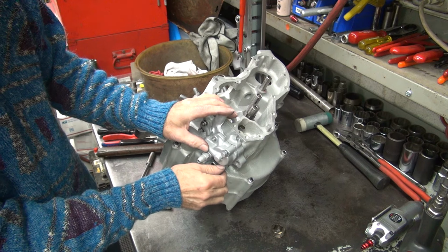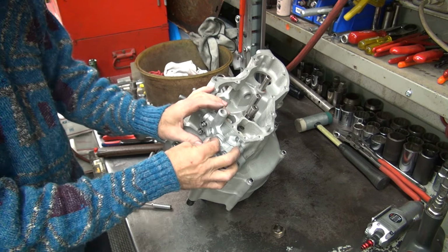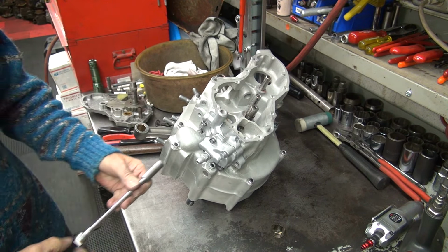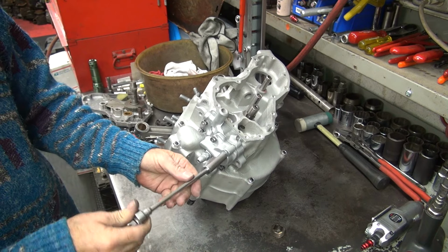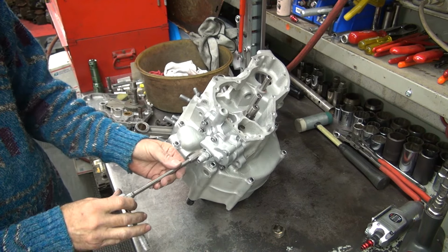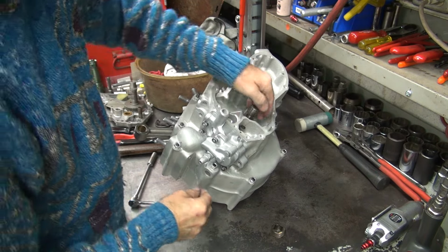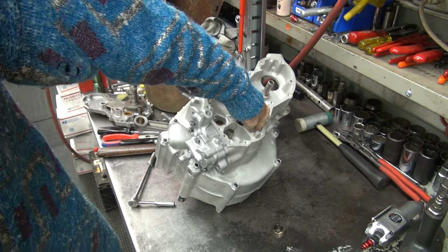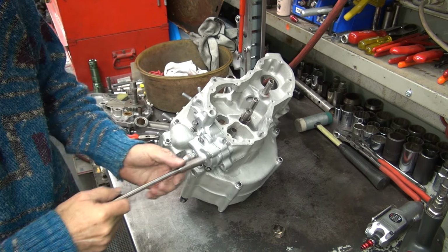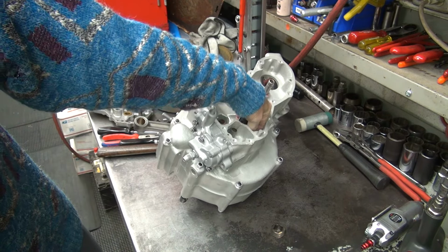You know, all these gears within 1 to 2 thou, if not lower. 1 thou. Okay, we know we got these two here tight. It doesn't drag. You can tighten these outer two down, it drags. Just need to tighten these ones up. Oh yeah, it locked us up. Big time lock up. Tight, we can rotate it.